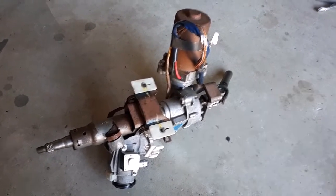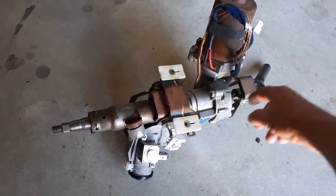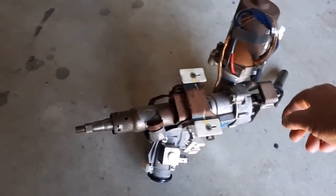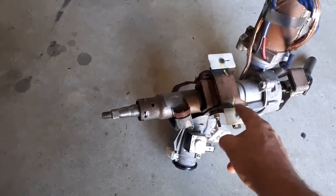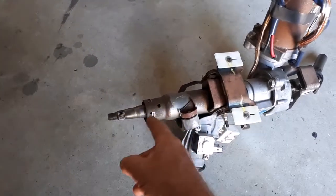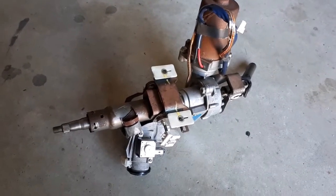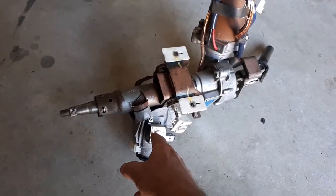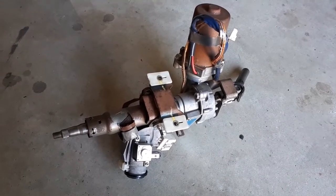Here's the item in question. You've got your electric motor there, some sort of a gearbox arrangement there, the shaft that goes down to the steering rack arrangement, and the steering wheel end here. By retaining this mechanism here you'll get a little bit of up and down adjustment in the column, plus in and out over about six inches or so, so I'm going to leave that in place. I don't need all this ignition business here, although there is a steering lock mechanism in there. It would be nice to retain that but I don't see how that can happen at the moment.